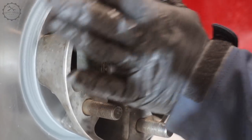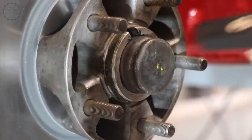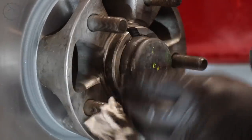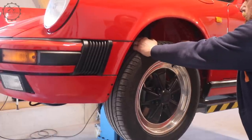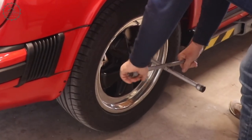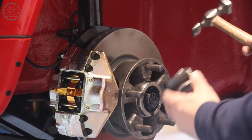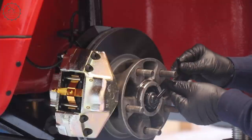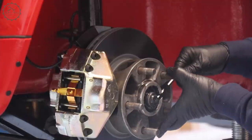Frankly, I doubt this is a good way of doing it. Obviously, the disc's lateral movements not only depend on the normal force, but also on the friction coefficient, and that depends on the amount and kind of grease, surface roughness and whatnot. Accordingly, when 2 weeks later I had the wheel on, I suddenly did sense some play that escaped my attention before. Eventually I turned the clamp further with little steps till all play was gone. And altogether, I guess, I ended up tightening it by about 1/8 of a turn from where I started.